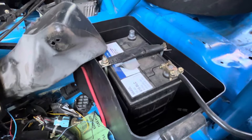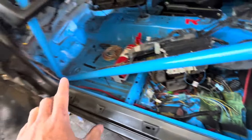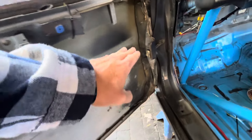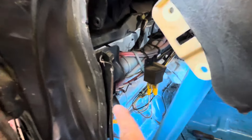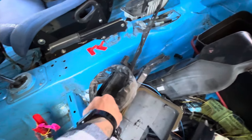Battery's mounted at the back — you have to try to keep the weight off the front of the car and try to centralize it. More has been cut out of this door; this bracket I just chopped off yesterday, there was another bracket here. Now it's become flimsy, but you know what — it's saving weight. All of this stuff, it doesn't look like much, but it adds up.